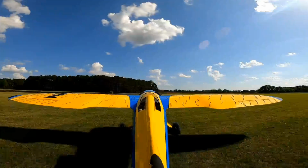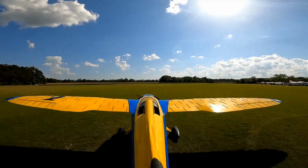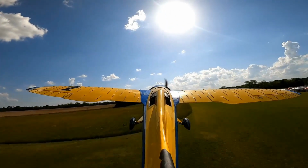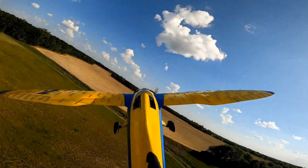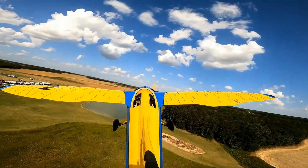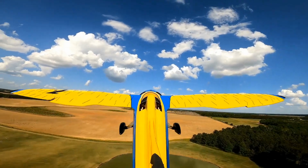So what we're going to do here is look at a video of me taking off. This is the first takeoff for this experiment, and you see all the yarns pretty much straight back. You can see a couple of places around the ailerons where the yarn separates when they deflect, and that's normal. But over most of the wing, this is pretty much a wing that is not stalling. At the very inboard trailing edge, you can see a little bit of separation once in a while, but that's pretty much it. Now in this video, I'm going to make a turn to the left.